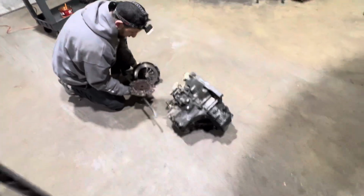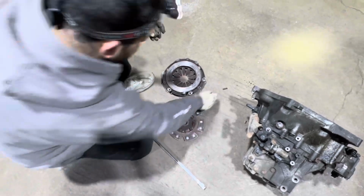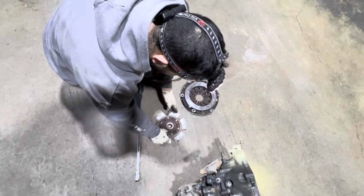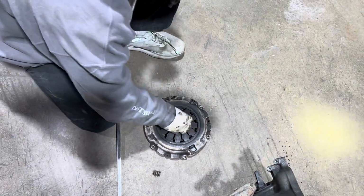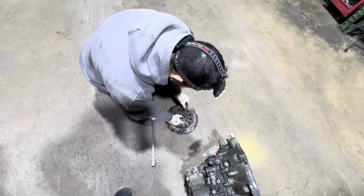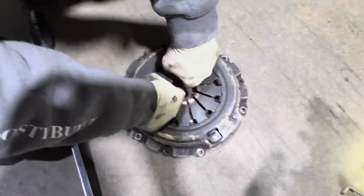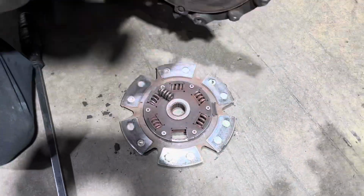Come check it out. Bring it over here. So this spring goes inside. Well, this one goes inside there. It's a dual spring. They all have it, and it goes in there. So what happens is, as you press the clutch, it depresses this diaphragm and this pressure plate and disengages the clutch. Now, if this gets wedged back here, I don't know if you can see that close. You can zoom in. Now, if that spring gets wedged back there, and I try to push, these diaphragm fingers will hit the spring and won't let it disengage.